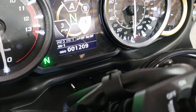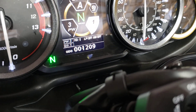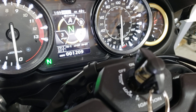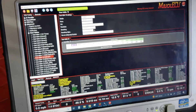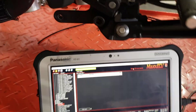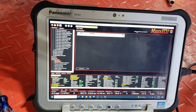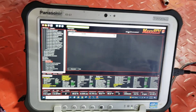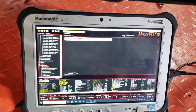Holding the mode button, you can go into quick shifter settings — there are five different modes plus off. You'll notice the check engine light is on; that's because I'm getting error messages from the Max ECU right now. The O2 sensor heating is one — because I don't have it plugged in at the moment. It's important when you do first startup that if you have fuel pressure or O2 sensors that aren't connected, that's going to cause strange compensation behavior. You want to make sure those things are either turned off or physically plumbed in and wired in when you first go to use it.